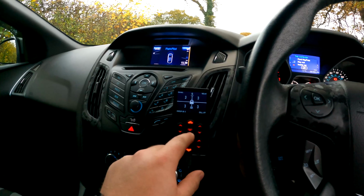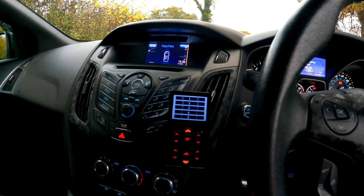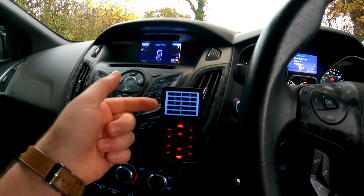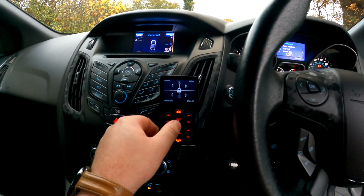So currently it's on 3 psi, you can air it out all the way, so it's on 0. If you press the middle button, you've got 5 presets. So I've got 115 on all bags, which is lift, 85 which I was just messing around with, 75 is the ride height, and then 0 for 4 and 5 at the moment. I just haven't got any use for them. Start up, it'll go to 3, which you can change.